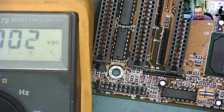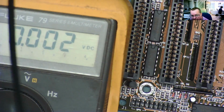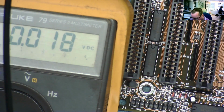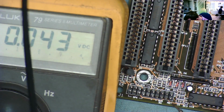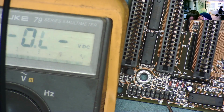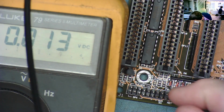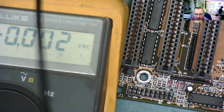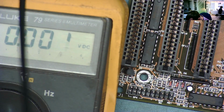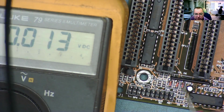So we can easily find this out actually. We just get the test meter and we connect to ground. I have the power supply plugged in. So wherever the switch is, the reset and the power, we should have 5 volts. There's 5 volts there. Oh, and there's 5 volts there as well. Is this 0? Yeah, 0. So it looks like the switches go vertically. 5 volts to 0, 5 volts to 0. What's on this one? Yeah, another 5 volts and another 0.